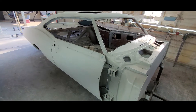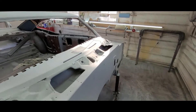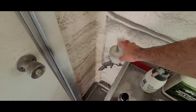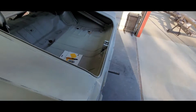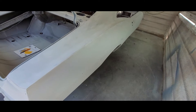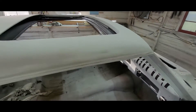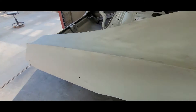I'm thinking at least two coats, possibly three — we have a whole gallon. Going to spray it with an Iwata Air Gunsa 2.0 tip, pretty good gun for primer. What works for the polyester works even better for the SPI. We knocked it down 80 grit, no need for any more filler spread which is good. We did have a little bit of breakthrough throughout but overall nothing of concern. Let me get to mixing up before it gets too hot out here — I'll bring you guys back once it's sprayed.